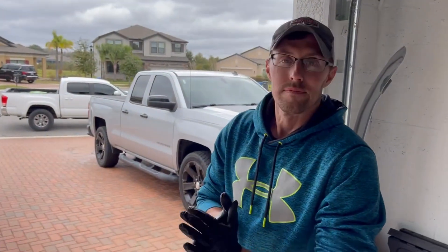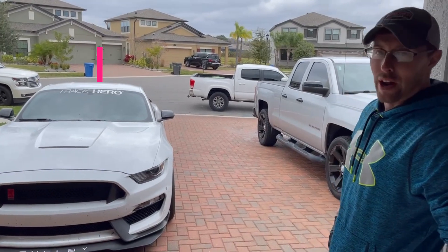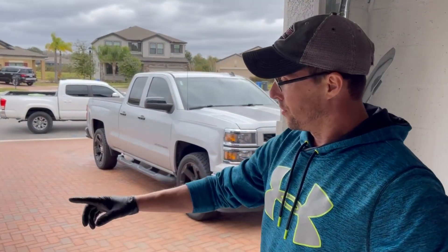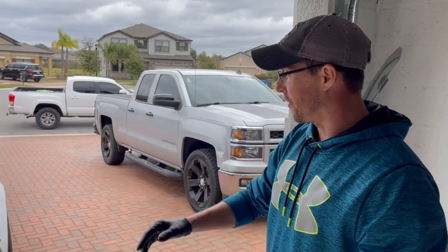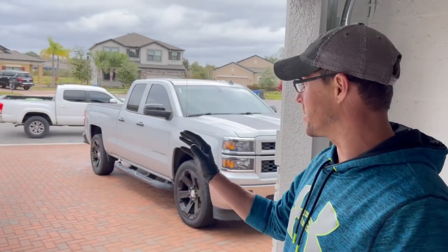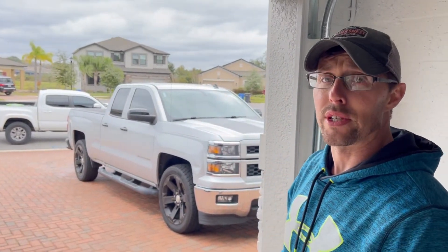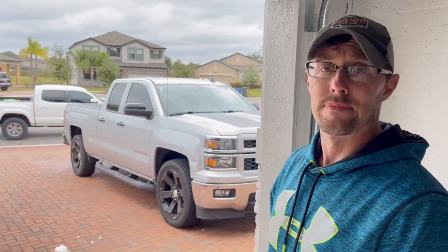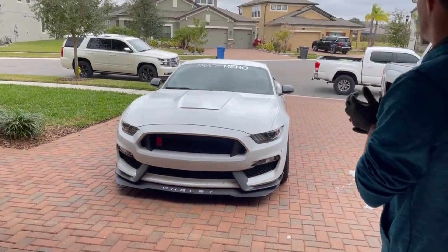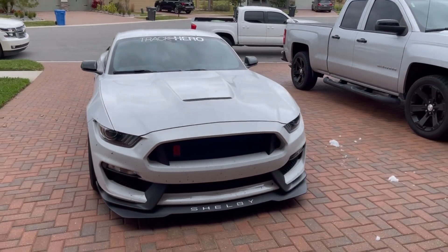This is Sean over at Monarch Auto Detailing — I'll put his information down below. What are we going to do to the car today to get it back looking new again? Well, I've got my work cut out for me today. I'm going to do a rubber removal and get all the rubber and gunk off the car, do a chemical paint decontamination — any rust or iron deposits on it we're going to get off — and then put a paint sealant on it: Gtechniq Liquid Crystal C2v3, to keep it shiny. Perfect, I'll let him get going on it.